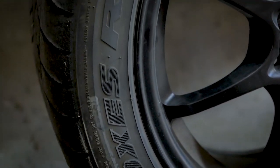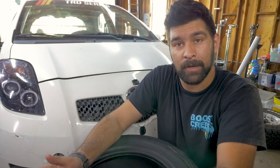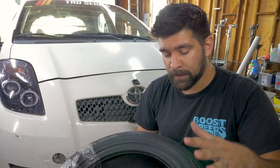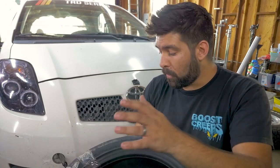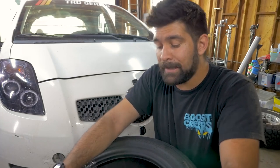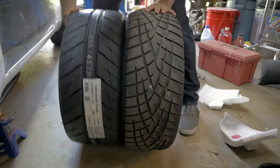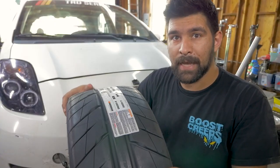The old setup was pretty nice to start out with but the Toyo R1Rs had a very small temperature window. They would start off pretty greasy and end up pretty greasy by the end of a session, especially out here in California. These Hankook RS4s are much better received, much better reviewed, and a lot more people run them so I get a lot more data. We're also starting on a fresh set with our new alignment so they should wear pretty evenly. These are 225 instead of 205 like the last ones — the widest I'm allowed to go in the enthusiast class — and that should give us a little more contact patch and a little more grip.